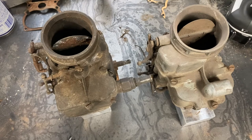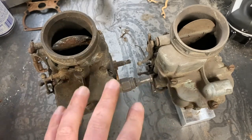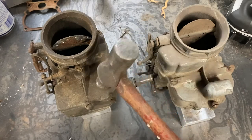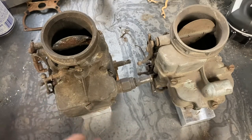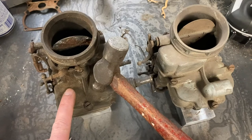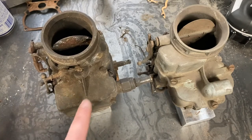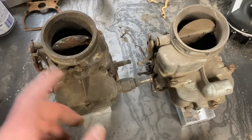Two things to consider when looking to rebuild cores of old carburetors like the Stromberg 97 or the Holley 94 are moisture and man. Man is probably the worst — it always comes down to an old man bringing in his truck with a crank-no-start scenario, and here comes Billy Bob with his persuader tapping away at the bowl to try and unlock a stuck needle and seat. Before you know it, you've got all these nick marks on the top of your bowl and now you're leaking out the sides because the casting is all crunched in. These are extremely delicate castings. Someone could have also over-tightened these screws and the ends will flare up and cause leaking in the corners.